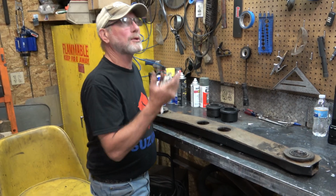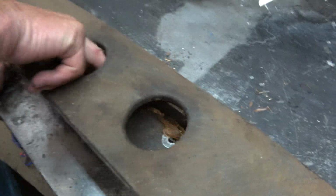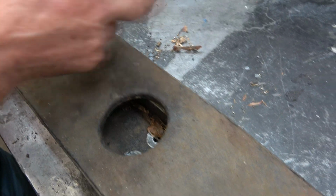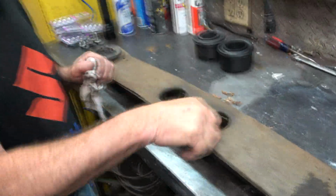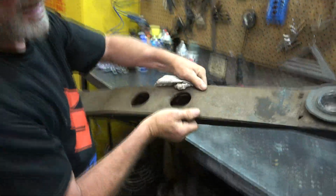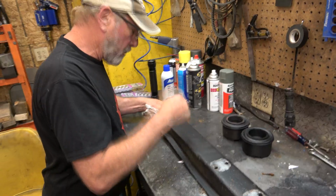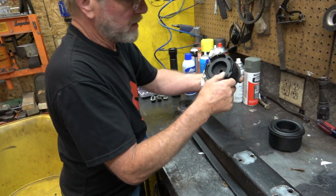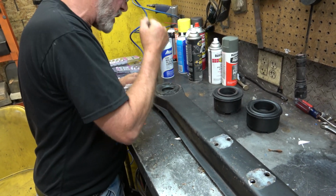This is a cross member and it's way up underneath a fiberglass car. And you'll see evidence of, I can only think that squirrels would bring this in, or mice. It's a mouse turd right there. But we'll have to blow this all out. That's the stuff that starts to rot. Look at that. Every time that gets into the bottoms of your fenders and in the trunk, it just holds moisture and rusts out. I'm thinking it's got to go back that direction, and they must have these so you bend them over. So we'll straighten them out, then we'll try to knock it back out.